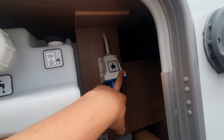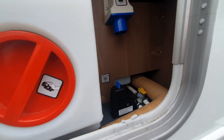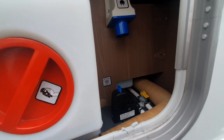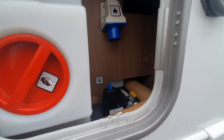Next, you've got your hook-up cable which is just here, and then below that your frost protection valve, and also your boiler drain down point. Your frost protection valve drains everything in the boiler, and your boiler point covers everything beyond that point in regards to your piping and things like that.